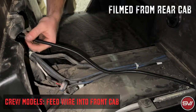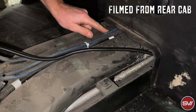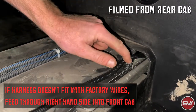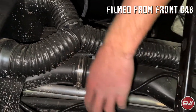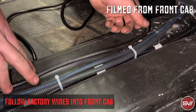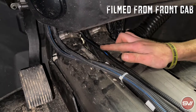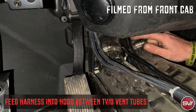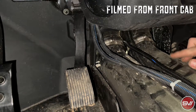So we brought the wire over the fuel tank. Again, it's just loose for now, following kind of this group of wires. On these North Star models, there's so many wires running through the middle that it's darn near impossible to get ours through there too. You can also run it on the right-hand side like we have here, and that'll get you access to the front. When we came on the side, that gets us to right here, and that's going to allow us to come up the front. This will end up getting zip tied into this group of wires here in the middle. We're actually going to run it right through the center of these two vent tubes. There are some other wires that run through there, but with that front part of this harness unplugged, you'll be able to get it right through there, and that's what's going to gain us access to go up into the hood.